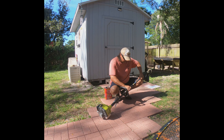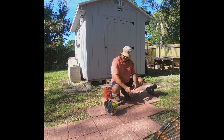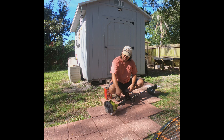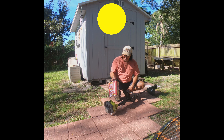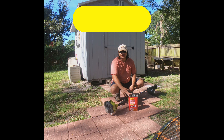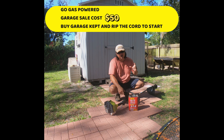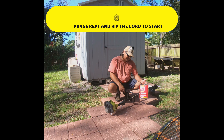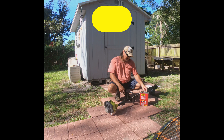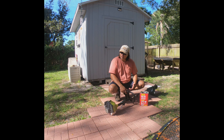Without a doubt, get one of these gas-powered Ryobi two-in-one or three-in-one units, because it gives you lots of options with the attachments. This runs about $150. Again, you've got to get the fuel mixture just right — it's a mix of gas and oil. You can use True Fuel cans, which are pre-mixed with a carb cleaner, just pour it right in. Or you can buy the 50-in-1 vials — about $3 each — and mix into a one-gallon gas can. True Fuel runs about $9 for the big can.